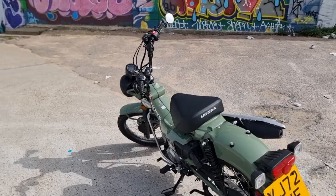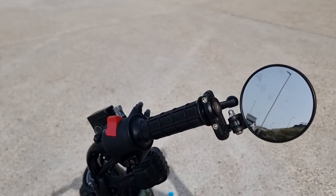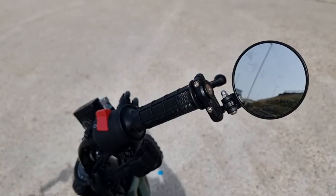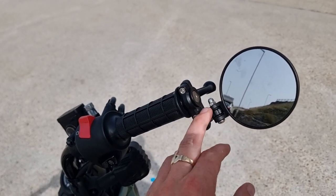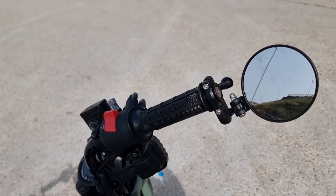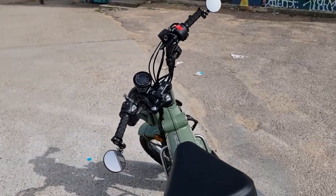The only upgrade I've really done on the bike is these little bar-end mirrors. On the bike you have to take this one out. Everybody's saying online that you take the screw out and that Honda, for some reason, glue the screws in there. But you don't have to. All you have to do is get a small flat screwdriver in here — there's little pins inside the bar-ends — and you just get the screwdriver in there and flick it out. And you can just pull them straight out, so you don't actually need to take the screws out.